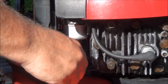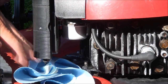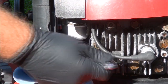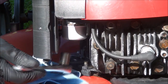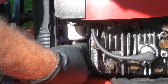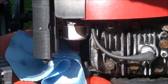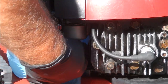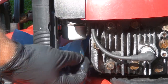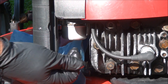There's one bolt on the bottom — be careful not to strip it. Now you will get some gas that leaks out, which is why I'll put a towel under here and put on a glove. If you have any remaining fuel left in the tank, this usually drains the rest of it out. There's the bolt that holds it on, and there's a gasket that goes there — it looks like it's stuck to the bottom of the float bowl.